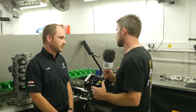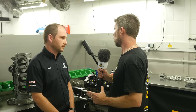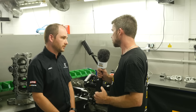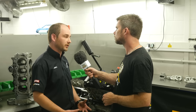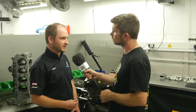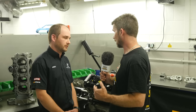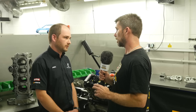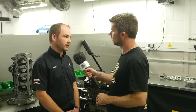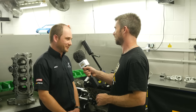Moving back to the crankcase — it is a casting, but these days we're seeing a lot of billet engine components. Can you talk about the decision to go with casting versus billet? Originally it was cost-driven — we wanted it as a relatively high-production engine. The billet route 15 years ago wasn't as accessible, so casting was the most logical route. If you are looking at a large production run, casting does often become much more cost-effective. In terms of numbers, we've produced well over 500 of these RPE V8s now, and the casting has proven well and truly up to the task.